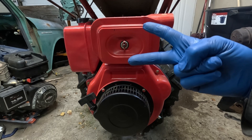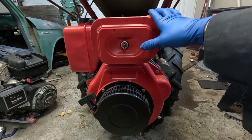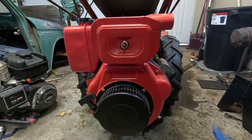We've got two main issues that make these motors — or just any diesel — tough to start in the winter. A diesel engine is compression ignition, not spark ignition like most cars or other small engines. The actual pressure of the piston is what fires it off, along with heat. Heat from the engine adds energy into the system that allows compression ignition to happen. Sometimes the engine isn't making any heat, so you've got to pull a little bit harder on that pull start.